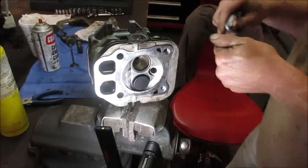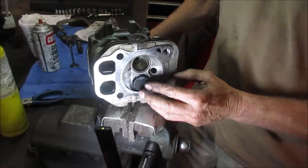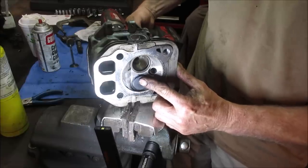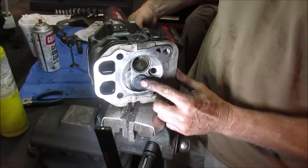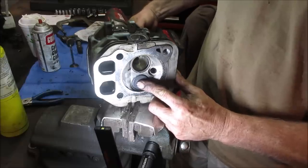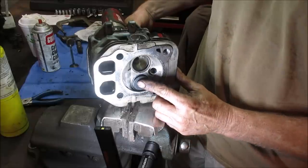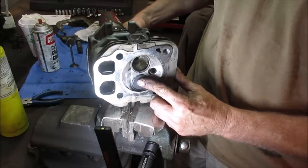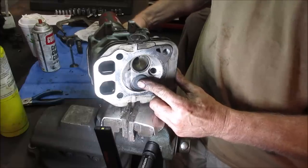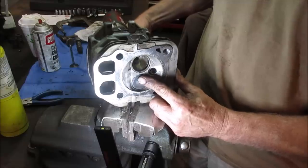Yeah, hopefully that light doesn't bleach you out. I got a hook to a drill on the backside. Let's see if you can get some lapping compound in there. And we'll give her a little. I'll lap my finger too. I'm just kind of listening to it. You hear how the gritty noise starts and then it goes to a fine one. Then I pull away and let the material go back in again because it just pushes it out. It'll work pretty good.